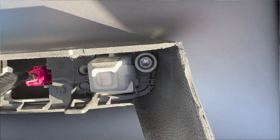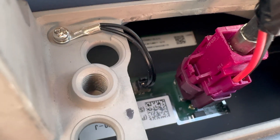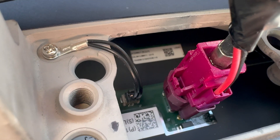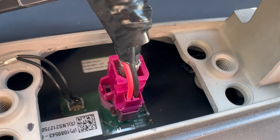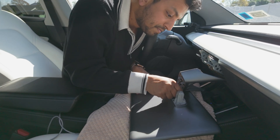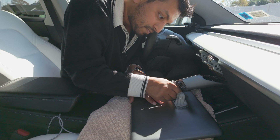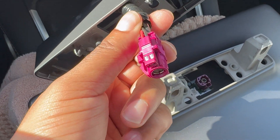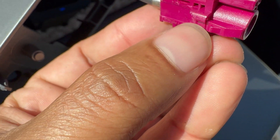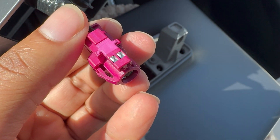You're now seeing this purple plug — you have to pinch and pull. You can wiggle a little bit but not too much. Push here on this pin and then pull out the whole cable and it's separated. Press right here in the plug — press and pull — that's the plug. Now let's install the new one.